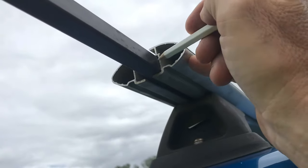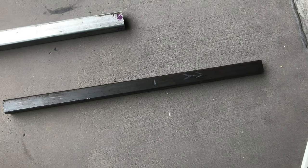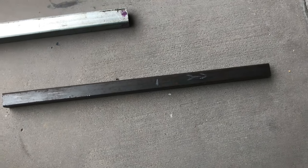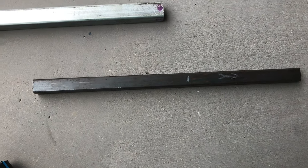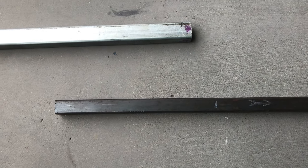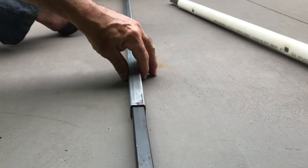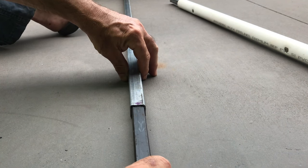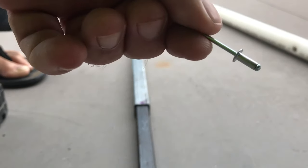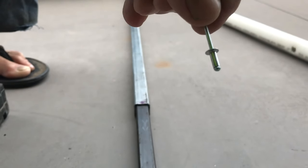It's as far in as it goes. I'll just get a white pencil and put a mark there. So there we have it — there's the mark, with a little arrow saying that's the bit that goes in the roof rack. That's the nice bit that goes into the actual steel. Now I'll simply insert the bar into the hollow square section — it's a nice snug fit. Take that down to that line. I've found a tiny little pop rivet, 3.2mm diameter, maybe 5mm deep.